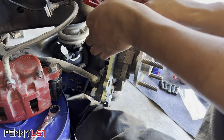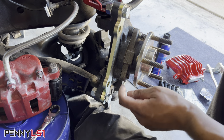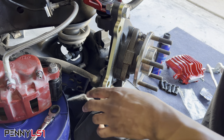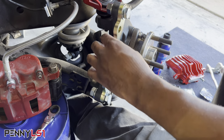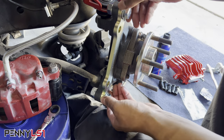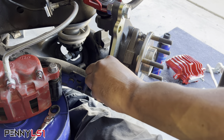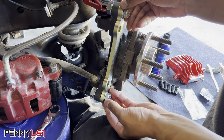This is just going to be mock-up. I did torque the hub bolts — those are 85 foot pounds, I believe. You can pull that up on Google yourself, but I believe it's 85. The kit did come with some blue Loctite for all these other bolts, but I'll do that later. The bolts for the hub had Loctite on them already. So as you can see, now it's flat. Clearance-wise, we're good — I think. I feel a little resistance. Let me show you at the bottom down there.